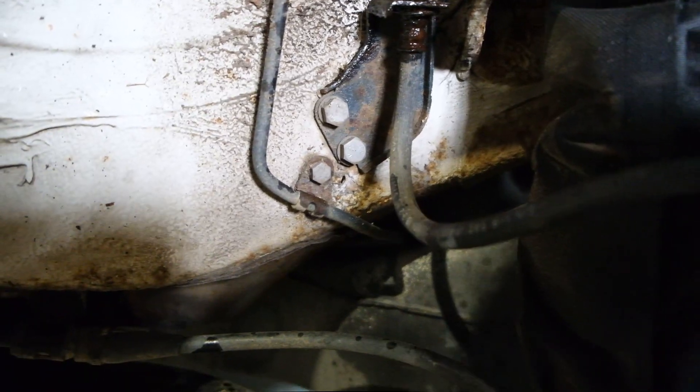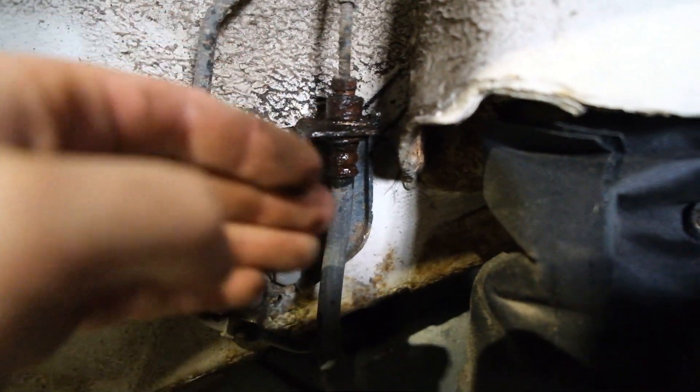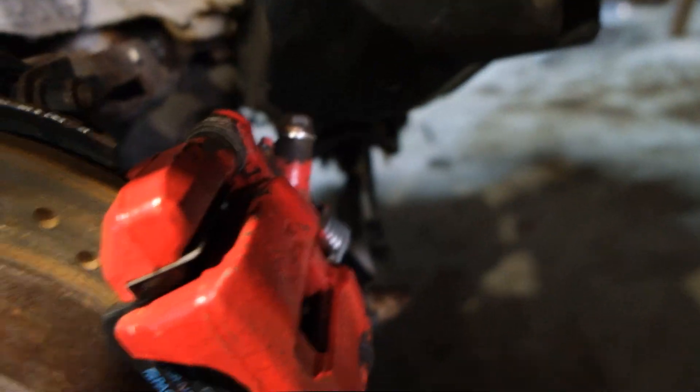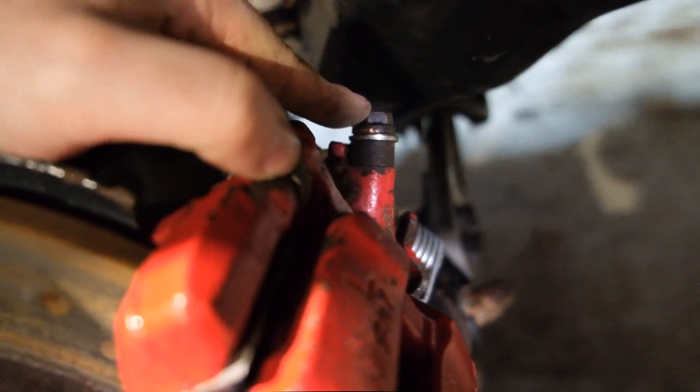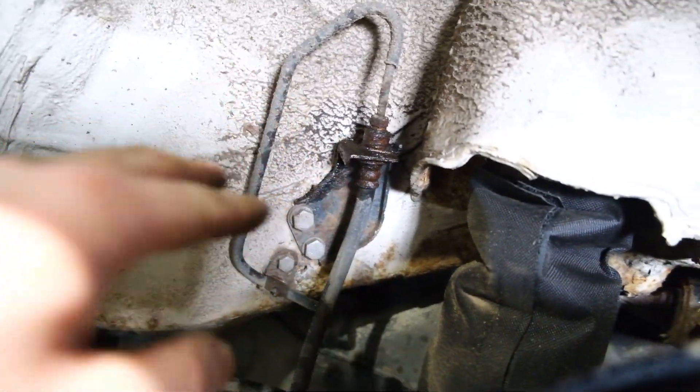So now that's off. I believe we just need to get a spanner and just loosen this one off, and then that will just come out of there. I'll take this one off at the back of the caliper first, get that off, and then look at getting that one off. Once we've got that one off, we'll be able to just take this one off and then get the new brake line fitted.